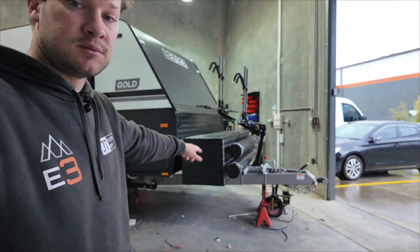For this van, we're not doing anything fancy like exterior lights or Starlink. We're just giving him extra power and an Anderson plug in his front box, as he's got another fridge in there. Being black, the fridge is going to get hot and will not run very efficiently, so I'll recommend the customer put some ventilation on that box.